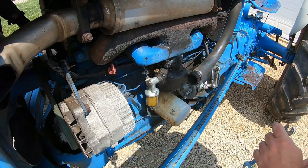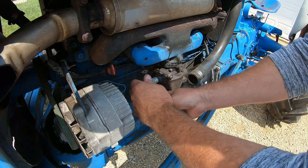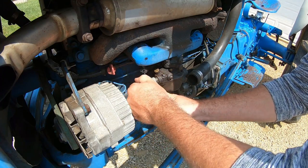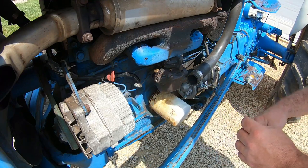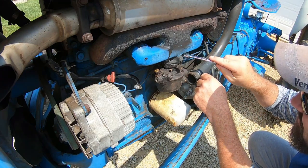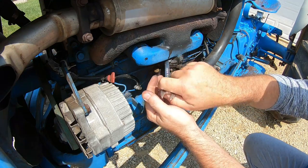All right, so we're back after it. We'll get this carburetor off — I almost forgot to turn you guys on. Got the fuel line loosened up, let's get it off. Then we loosened up the sediment bulb, let's get it off. Absolutely crazy, that's a 14 millimeter — what's a metric bolt doing on this 1964 tractor? Got the sediment bulb off. We're gonna reuse some parts off of it here in just a minute. And then I got to looking at these bolts — we took our air tube off there, somebody has stripped this joker out.